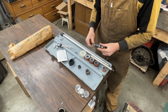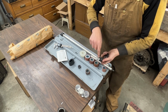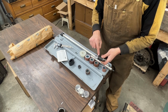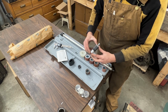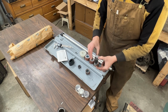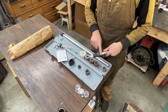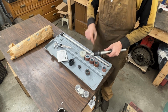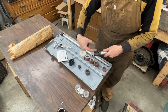So this is actually a bolt. You see it goes through. Well, it's not a bolt, it's a threaded rod with a nut on it, but they put this pin through, so now they turned it into a bolt. You have this taper here, and you have these 4 pieces of this cylinder. When the cylinder gets compressed into the taper here, these 4 parts open. So when we tighten this bolt, the washer pushes these 4 parts towards the taper, and then this diameter here expands.